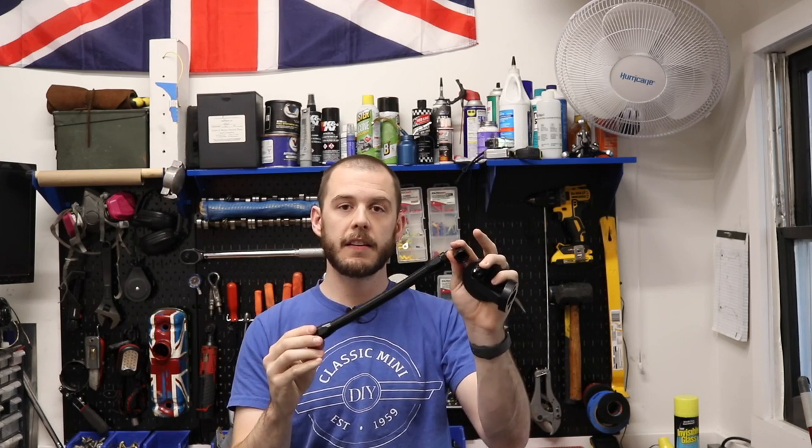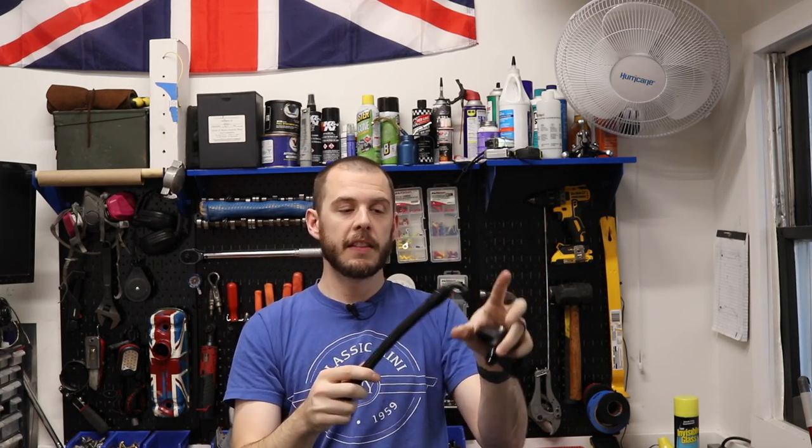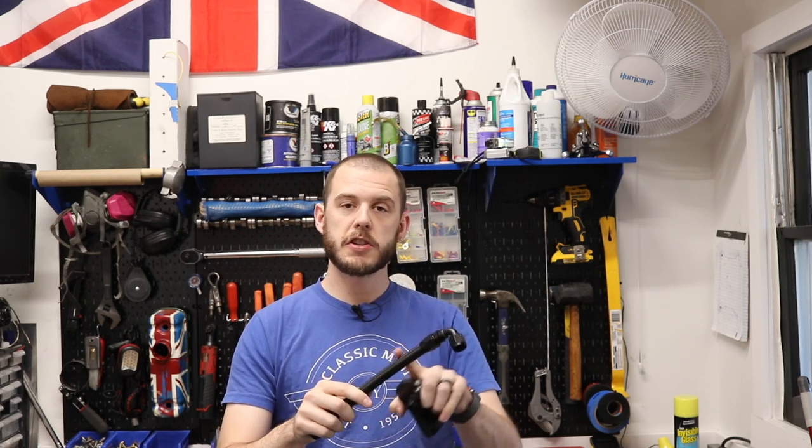So with winter coming around, I figured it'd be a good opportunity to try out this new MED filter head, as well as some nice AN line. This is 8 AN - this is the return line. So instead of having an oil cooler, this is just a line that runs from the filter head up to the block. It's a lot tidier, really cleans up the engine bay, and provides a larger diameter hose than the original stock fixed line.